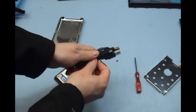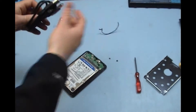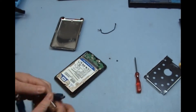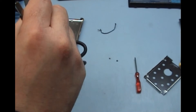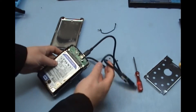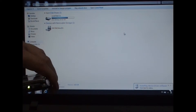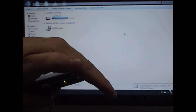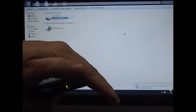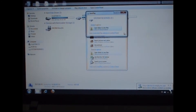What we are going to do is get this connected up to our computer. We don't need to put the cover on the caddy for the moment. We just take our USB cable, plug it in this side, and plug the other end into the computer. We can see the activity lights on the hard drive, which is good — it means there is power and it is trying to read. So it should come up on the screen here in a moment, indicating that the hard drive itself is not actually damaged.